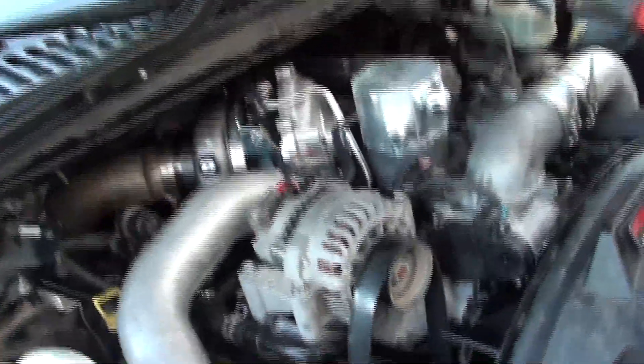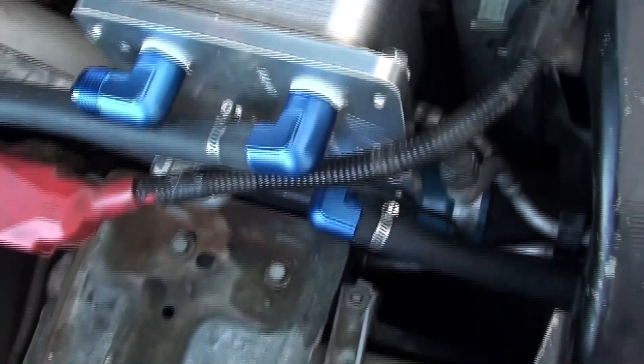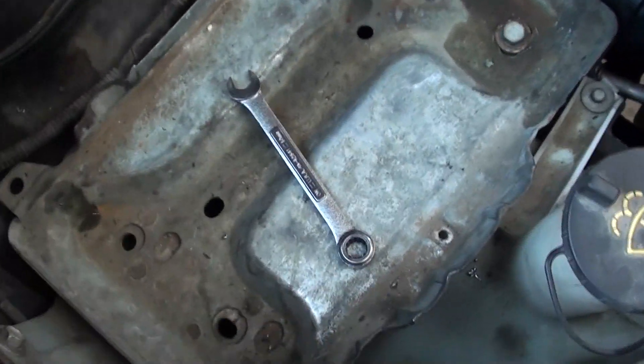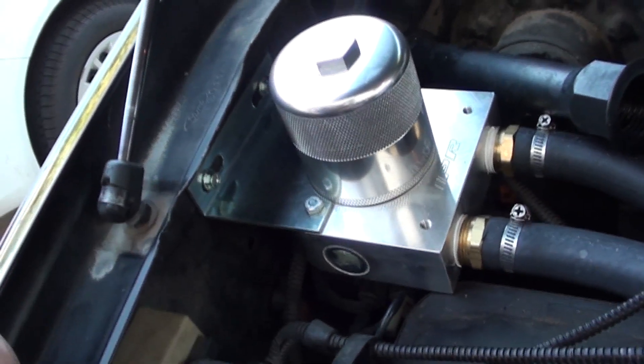It's an expensive kit, and I was hoping a little bit more for a straight-up bolt-in, hassle-free. It took me a few tries to get this thing right - at first it did not look like it was gonna fit. I would definitely recommend taking the battery out too. The cooling filter was really easy - the main thing is just make sure you don't go too tall or you'll hit your hood. And definitely don't over-torque these bolts - that's what it says in the directions - cause they'll just strip that metal right out.